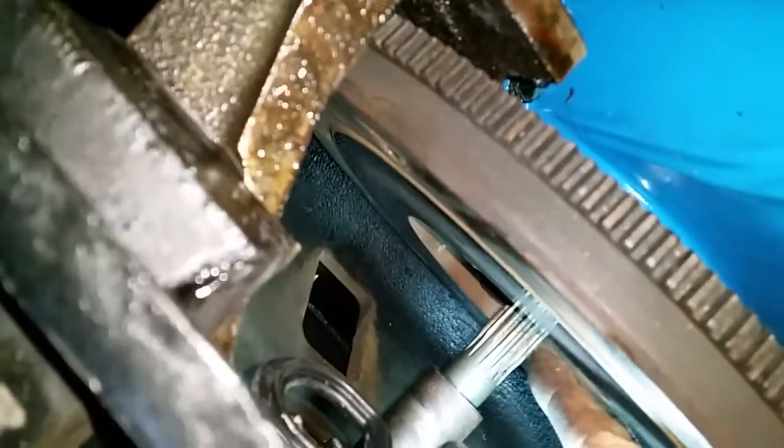Guys, we're back. T5 slammed. Not a problem. Like I showed you before, I cut the collar back about 1.25 inches, I think I told you, whatever it was. Hopefully somebody was taking notes. And the input shaft, I took about 3/4 of an inch off of that. But basically all I'm saying is you make it the same length as a 3-speed transmission.